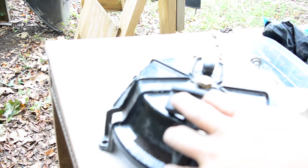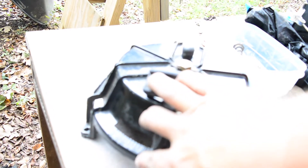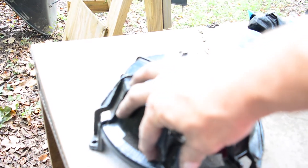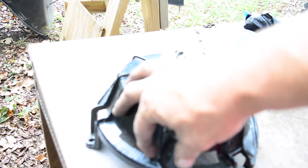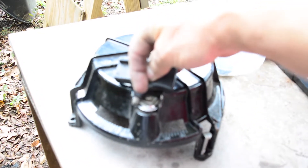So there's our 33 degrees before top dead center, and there's a two-degree mark for idle. Actually, if we call this zero, the idle mark should be behind it — two degrees before top dead center. My mark is off; I'll need to put this back on and correct it.